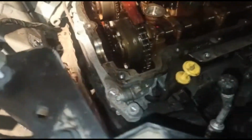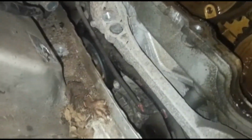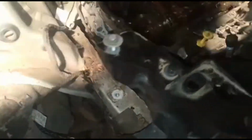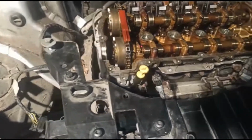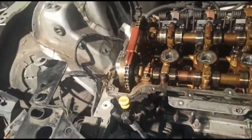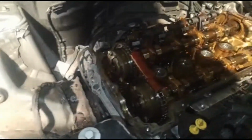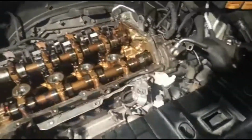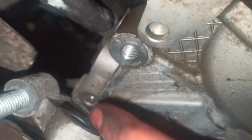And I just want to loosen up the alternator belt or serpentine belt, to be able to then get off that bottom pulley. And then from there I've pretty much got most things off for the head that I need to. And the tensioner at the back, just over here, it's 27mm. I've just taken it out, but I thought I'd mention it.